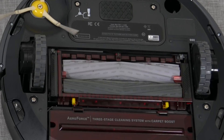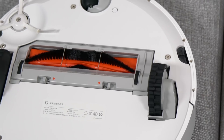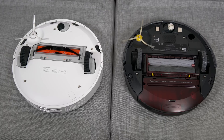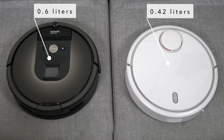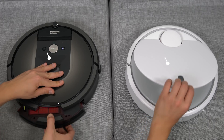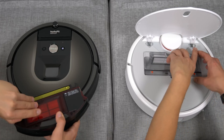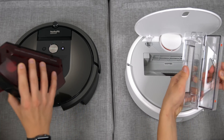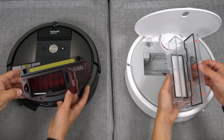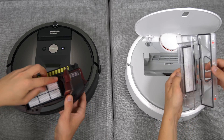There are also differences in how they collect and store dust. The iRobot 980 uses counter-rotational rubber brushes, while the Mi Robot uses a single brush with nylon brushes in between — we'll see in real life which is more efficient. The storage capacities are 0.42 liters for the Mi Robot and 0.6 liters for the iRobot Roomba, both larger than the Dyson's 0.3 liters. A key practical difference: the Mi Robot opens from the top for easy cleaning, while the iRobot ejects from the back and requires turning it around.